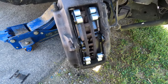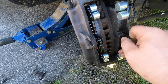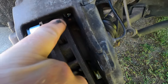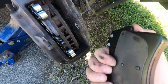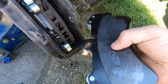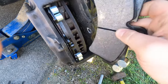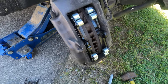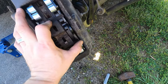We're pushed together. Here's a new pad sitting in there — had plenty of room. What you want is these points of contact: you can see right up in there, they're gonna sit on this lip on each side. So a little bit of grease there. We want grease on the back — just a small film of it for where the pistons are gonna touch. And then we'll need a little dab of grease along these holes and where the spring clip's gonna sit on.